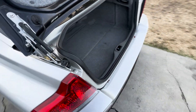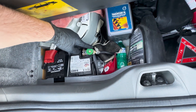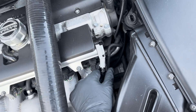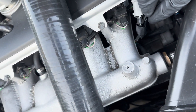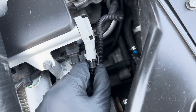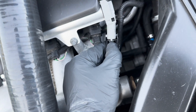Before we do any work, we're going to remove the negative battery cable. On your car it will be a 10 millimeter bolt. Then we're going to disconnect the fuel pressure sensor on the fuel rail - it'll be this clip held on with a little extra clip on the fuel pressure sensor itself. You may have to use a flathead screwdriver to pry it off. Do not pull it by the wires - it will damage it.